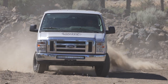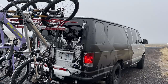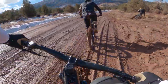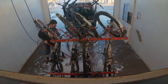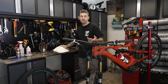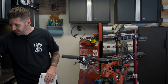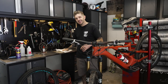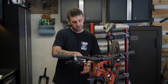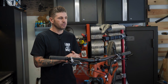Another thing to consider is your driving situation — driving over snow, slush, or de-icer. Even dry dust, if you're going down dirt roads to get to the trail, all that stuff flies up and lands on your rotors and pads, and as soon as you start that first downhill it gets baked in. You might want to consider covering the brakes for transportation, especially in really inclement weather or on a long road trip. Isopropyl alcohol is your best friend when it comes to cleaning and maintaining brake performance. It dries great, leaves no film or residue, and is safe on rubber O-rings and the rest of the bike. Spray it right into the brake caliper to get on the pads — highly suggest doing that to prevent contamination, dirt, and gunk from getting on your brakes.